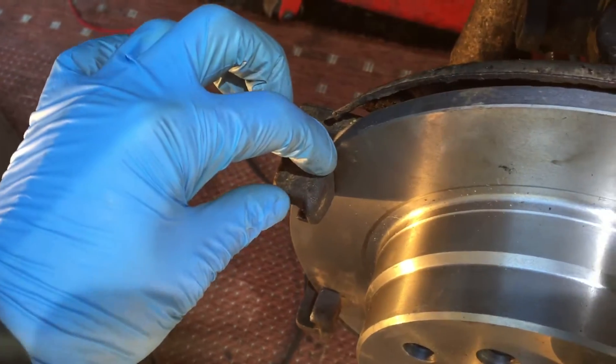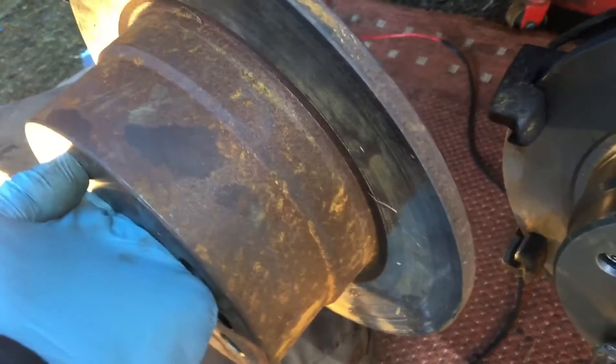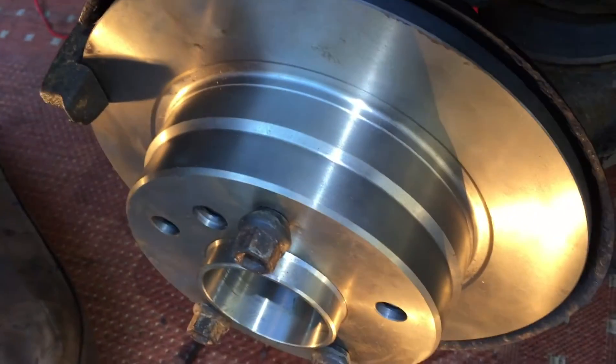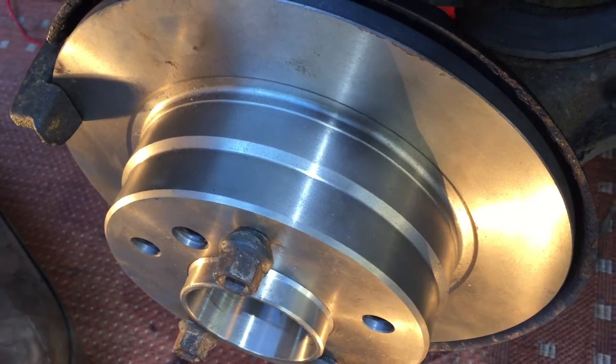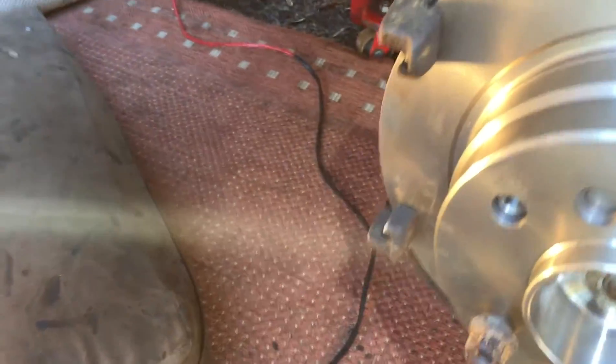It's just a bit close there by a millimetre, but I'll quickly show you the difference. Here's the disc that came off my car — you see how high it is, or how deep it is — and here's the disc from the 3 series. They say the difference is 23mm, and the key, I'll repeat, is the Z4 hub that's underneath that disc.